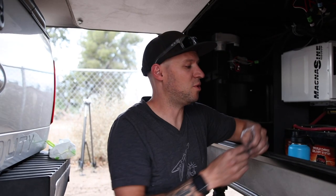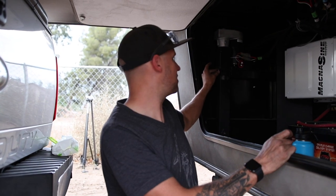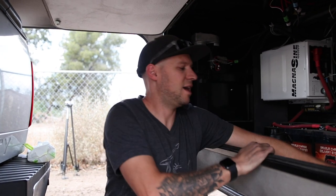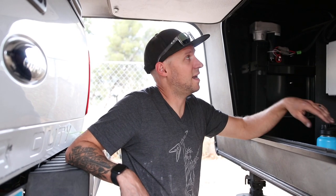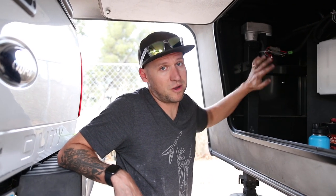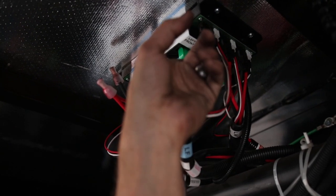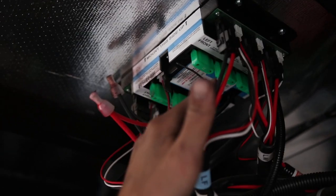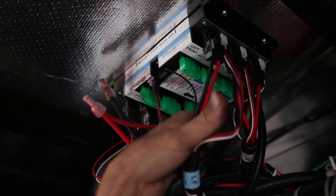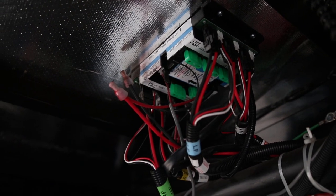For bonus points, it wouldn't hurt to have some locking split washers that are the same size as your main carriage bolts and some blue thread locker. The first thing we're going to do is disconnect the fuse so that we don't have power going to the jacks. For the Ground Control 3.0, you have a 30-amp fuse for each of the jacks: left front, right front, left mid, right mid, left rear, right rear. We're going to pull the right front to disconnect power to this jack.